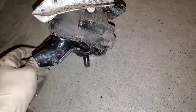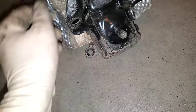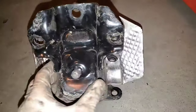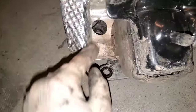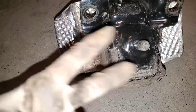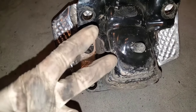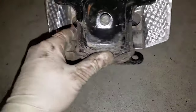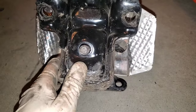This is the serviceable part of the engine mount — there's a little rubber part that would go bad and need to be replaced, but you've got to do the whole thing. There's also a little alignment dowel, so if you can't get it to line up, it might be due to that. Those four bolts — this is what it's going to look like on your end when taking them out: one up there, one down there, one up there, one down there. You cannot take the heat shield off. Mine was missing a bolt, which means two bolts missing out of this project — I'm going to have to go to the Ace Hardware. Let's get to it and put this thing back in.